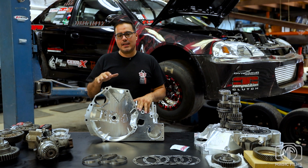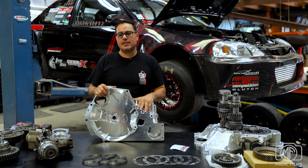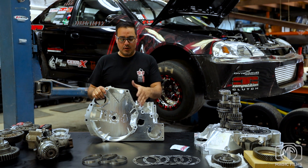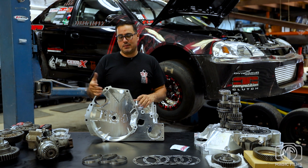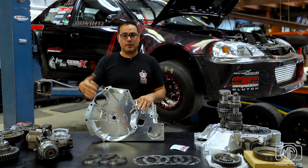The goal with this project was to make an H22 all-wheel drive Billet Bellhousing that uses all your existing H-series parts, such as the gear set, clutch, starter, motor mounts — everything that you have for your H-series will bolt directly into this. It's pretty much a plug-and-play operation without any special adapter plates or flywheels.